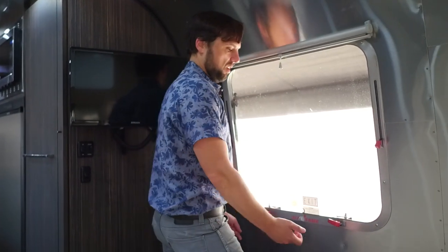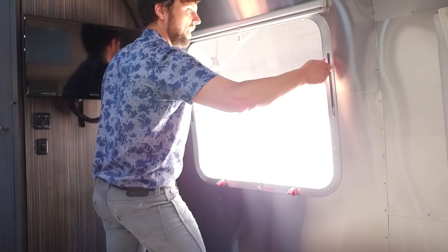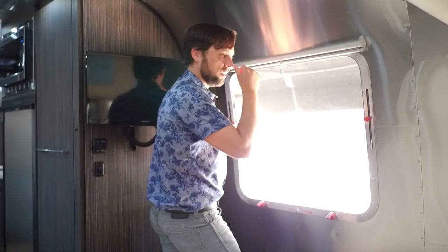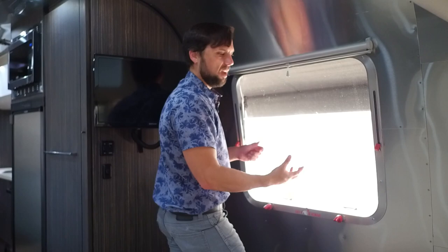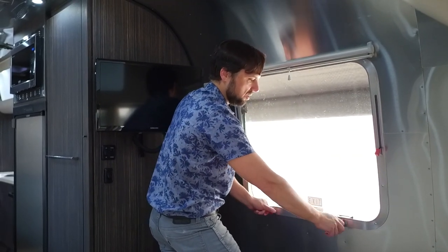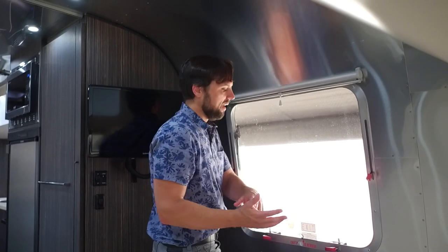The emergency exit is a big 30-inch window. Pull the two red handles, twist, and lift evenly with both hands, then snap it firmly into one of the height positions. Only put one side in causes stress and could shatter the window. There's a low level that leaves it cracked just enough so hard rain doesn't come inside. Very important — before you tow, lock the window, because wind pressure will suck it out when towing. I always walk through the trailer with a checklist before towing.